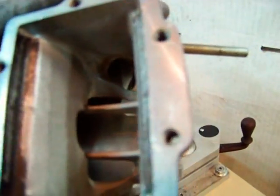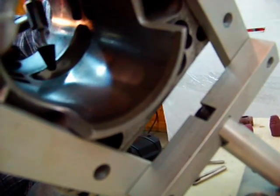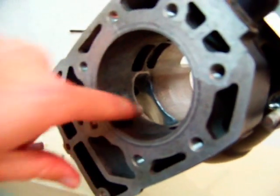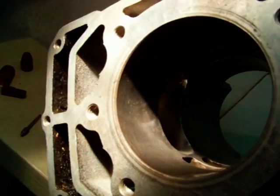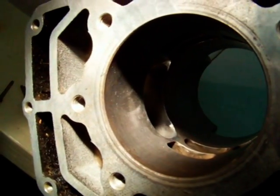You really can't go wrong with this. We're just smoothing out those little port windows — nice and smooth, working the entire process. Spend a little time on it, get it done right, don't rush through it. The old finger test — smooth as can be, smooth as can be. Let me put a little light on that and you can see nicely right through there. Those windows are nice and smooth; piston rings aren't going to snag on that. It's gonna work perfect.